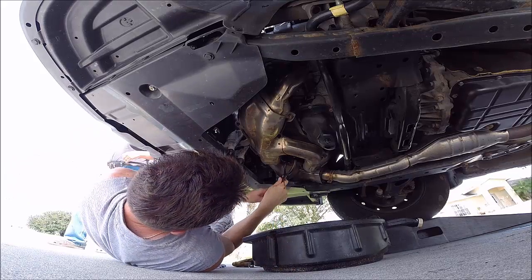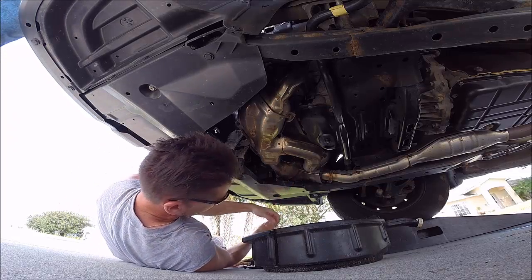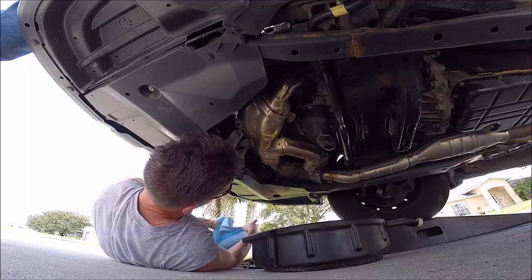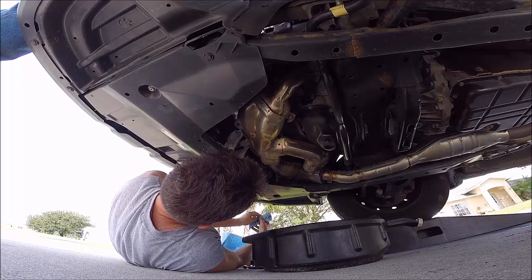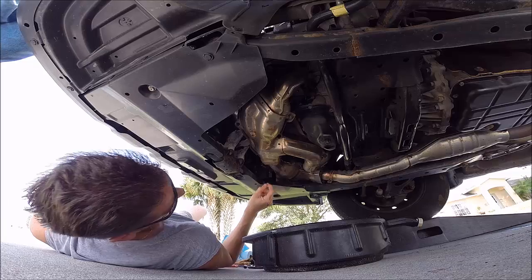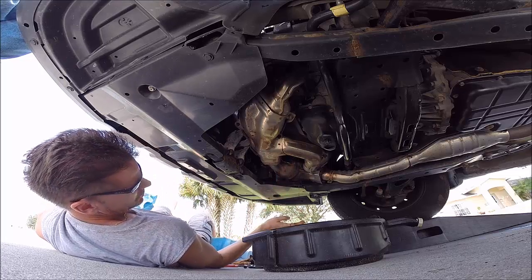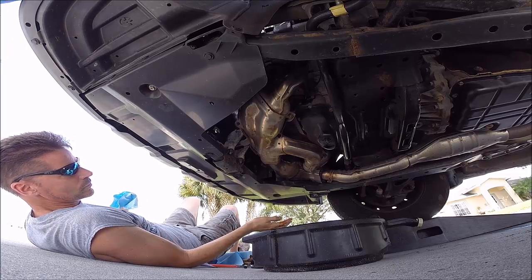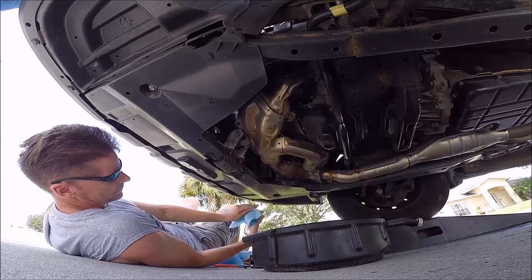So the exhaust manifold is hot. It's really loose. Where do you have this changed at? Like an oil garage or the dealer or what? The garage. Yeah, they probably don't have the right kind of tool either. It's not supposed to be super tight, but that was not tight at all. But it wasn't leaking. There was something in the manual that said 1 turn, and if it was turbo, it was 7/8 of a turn. So I usually get it hand tight, and then I'll put the wrench on it and crank it a quarter or a half turn.